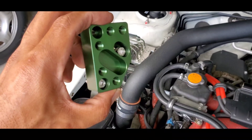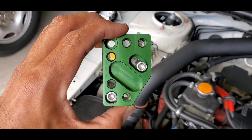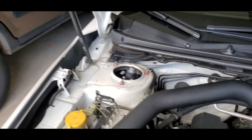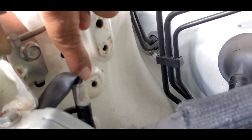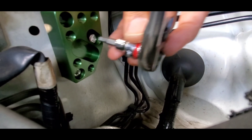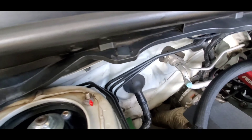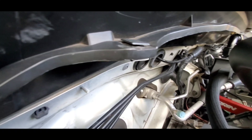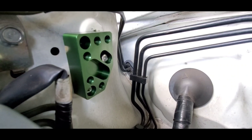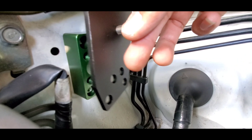First things first, the mounting bracket. There's a block that can be suited for different types of cars — Subarus, 15-plus STIs. The WRX is different but this is the orientation we're going to use. Two M6 bolts oriented just like that, mounted onto these two holes right here. The instructions don't tell you, but this upper bracket — I tried test fitting it — you're going to have to remove this little tab here which protrudes downward. For 2015 models we use these three holes with M8 threads.